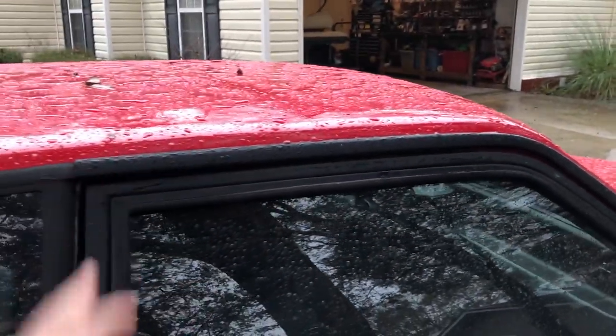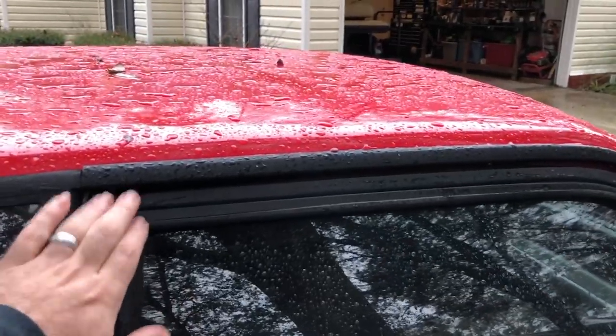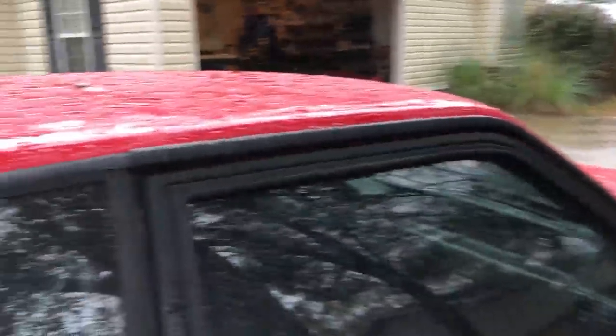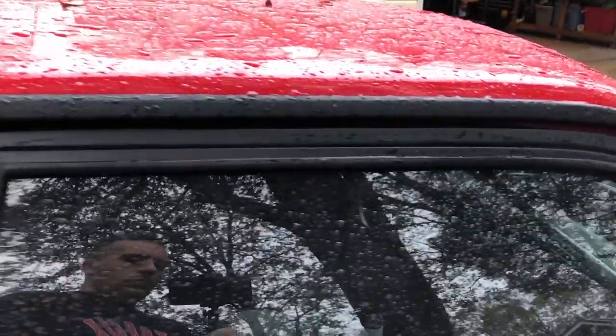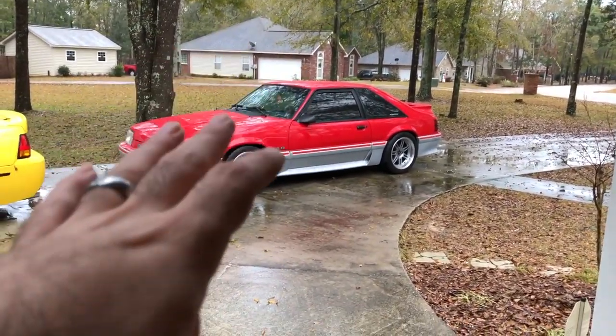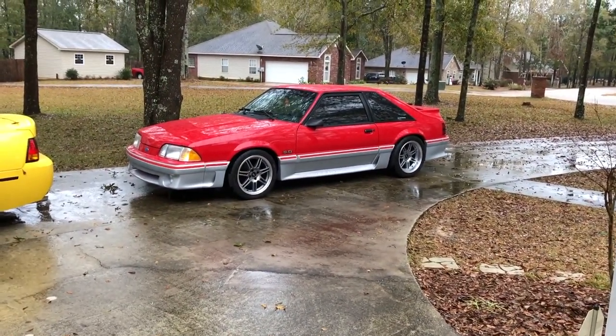Let's say you put in some new weatherstripping and it's still leaking — go to this, try it. Pull on one side of it, you'll feel it bend a little bit, and then you'll have no issues with that window sealing up. From my understanding, that's the way Ford would address that issue when these cars came in when they were fairly new — still on the car lots. They would put a board across them. So those are all the ways you can pretty much adjust your doors.